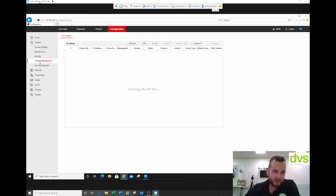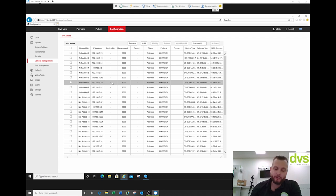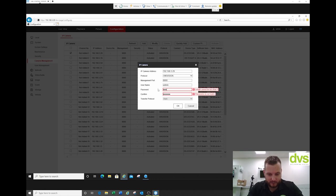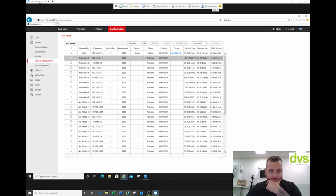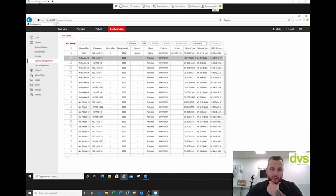Security — you've got the whitelist function. Camera management: click refresh and you'll see the camera. This is seeing all of the cameras on my network in the demonstration room. That's the one we activated earlier and we're going to add this. Even though it's on the PoE port, it's actually transparent on the LAN side of the network. So we're just going to click on that and click add, type in the password, make sure it matches, and click add. Sometimes they take a little bit of time to come online — and there, online, camera one.